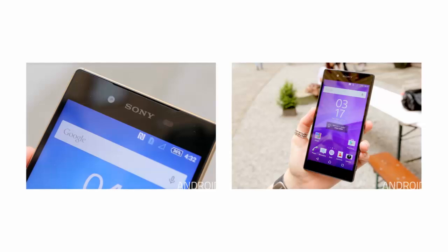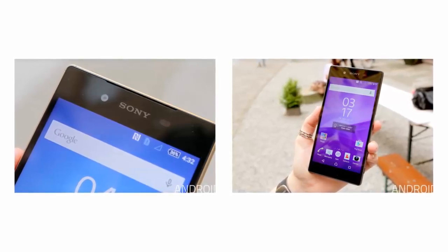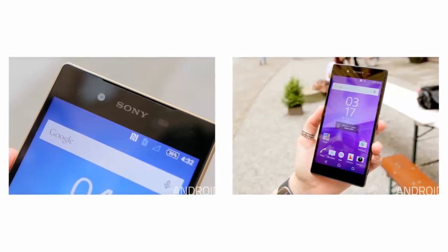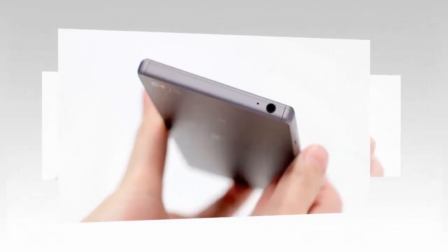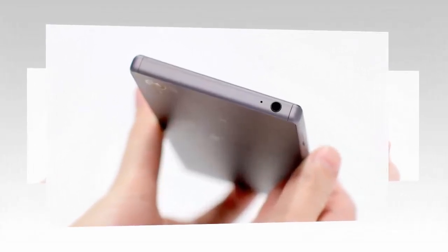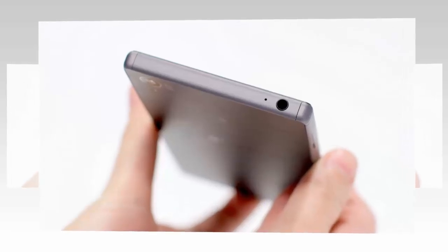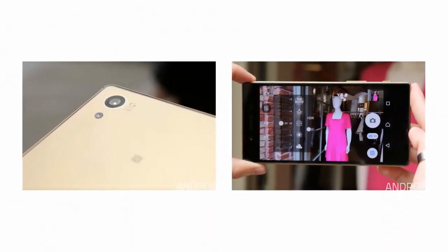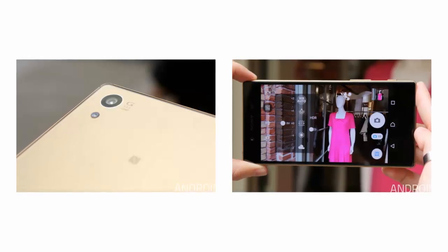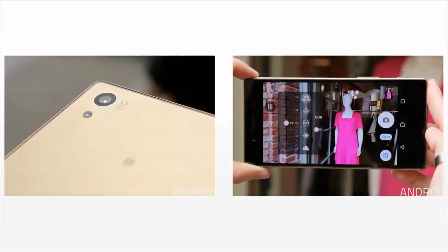The touchscreen on the Sony Xperia Z5 may be affected by custom screen protectors, so if you have one, it's worth removing it to see if it's the cause of the problem. If not, Sony says that excessive heat can also affect the Sony Xperia Z5's display. As we mentioned above, manually resetting the Sony Xperia Z5 using the button near the memory card slot can work wonders. As an added bonus, you won't lose any settings or personal data by trying this out.